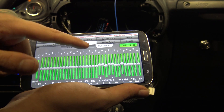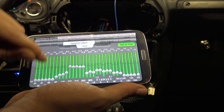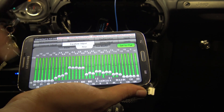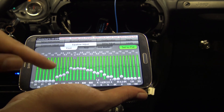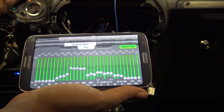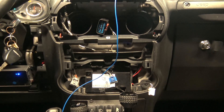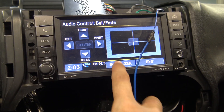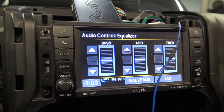The app's really easy to use — you just go through and set your EQ. This would be easier on a tablet since you'd have more room to get in there with your finger and move everything. Doing those changes to the rear and the front, you can see I had to cut the high end completely out and the low end completely out, and kind of bevel the mids. It's a lot different in the rear, and that's just because of the enclosure — I have the same speakers and amp front and rear. Doing all of that allowed me to have my equalizer set flat instead of it being all crazy like it was before.